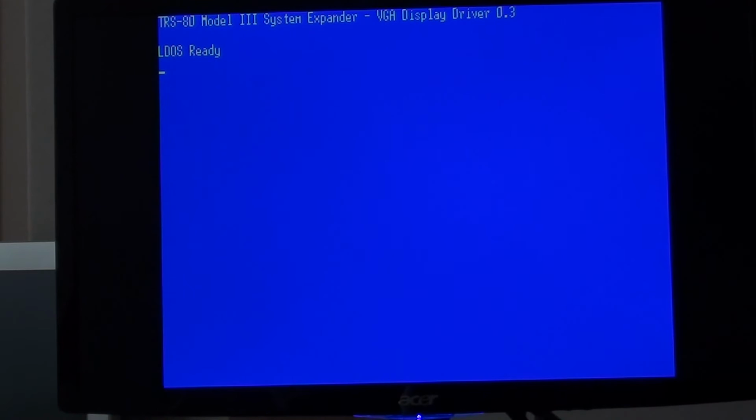creates an individual packet which has to be sent over the wireless device to my router across the internet to the server. The server generates a 1 byte data packet in return, which has to go through the same path in the reverse direction, and so you get a bit of lag, and you have to type fairly slowly if you're on wireless. It can be done, but I don't really recommend it.